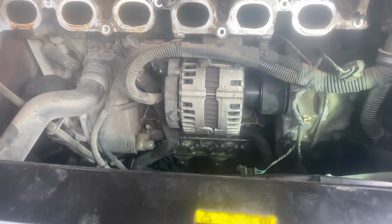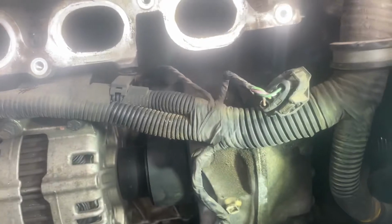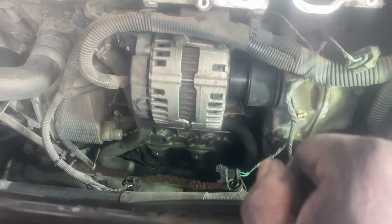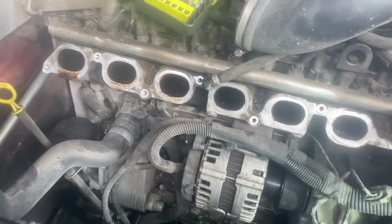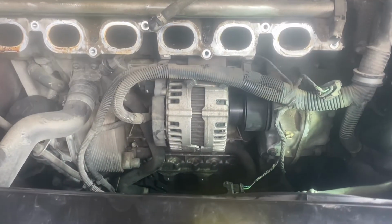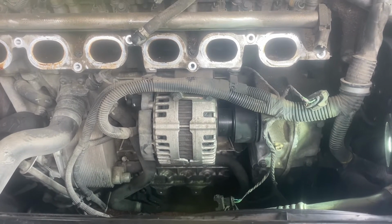And when you are putting it back, just make sure before you put back, look into the intake manifold of your engine to make sure nothing dropped in there. Just make sure nothing dropped in there. And if you want, that could be the best time to clean your intake manifold whilst it's outside. You may need to clean it out. It will help you a lot. By the time you put it back, you will not need to ever remove it again for cleaning purposes.